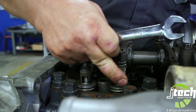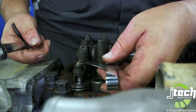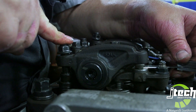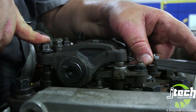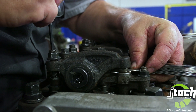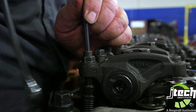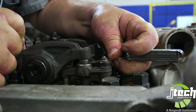You'll notice that there are bridges in here that are loose — these bridges operate two valves simultaneously. So we're doing the exhaust valve, which is 24 thousands. On this particular engine, you'll notice that this spring on the push rod has got to be pushed all the way down, and then you check your adjustment. If you fail to do that, your adjustment will be off. We'll take our five millimeter Allen wrench and push down and adjust at the same time. You want to do these right to where there will be just a little bit of a drag. At that time you'll tighten up your nut, still holding your adjusting screw. Recheck your adjustment — you still have a slight drag there. That's really good.